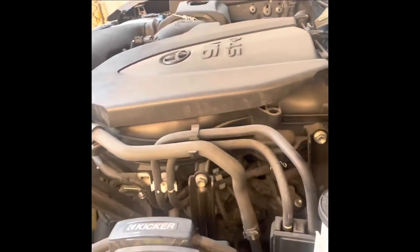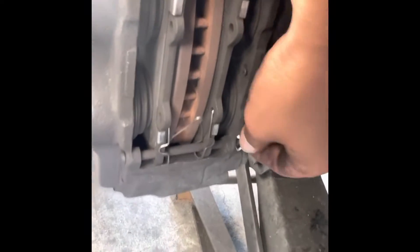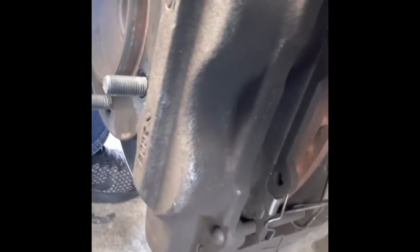For this step, take off this pin — it's gonna hold the caliper. Just pop them up. Don't worry if you lose it, new ones come with the kit. You gotta take off the bigger pins first. I like to grease them up — you can see how dry they are so they won't seize on me. Make sure I keep them in order, left side and right side.